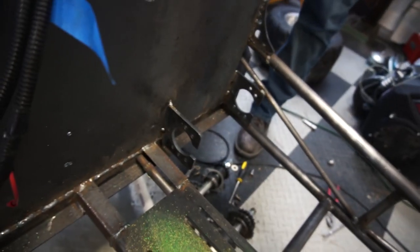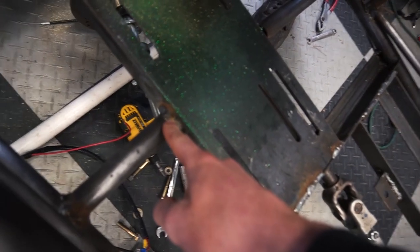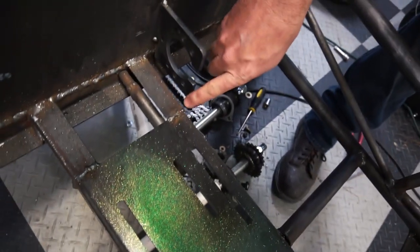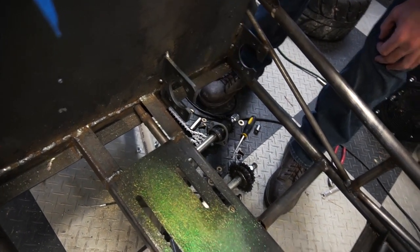Good morning - it is painting day! We need a little bit of welding to do first though. We have a couple spots: this side of our new axle hanger, the engine support brace - there's a little gap right there and I did want to join it. We also got little washers I wanted to weld in the dash area for mounting, and a piece of metal to fill in a hole.